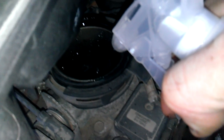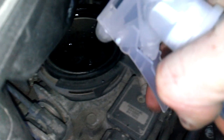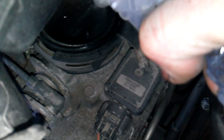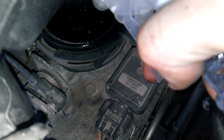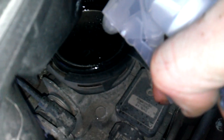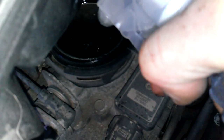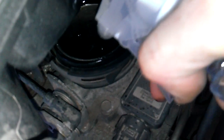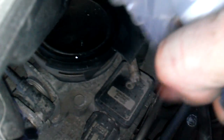See how she bucked there for a second? Now let her sit. Take it easy, because you don't want to seize your engine. If you put too much water in you'll hydro-lock it. Now look at the smoke coming out of this thing — it's getting all the carbon and crap out of your engine.